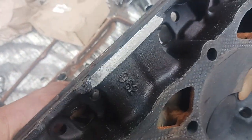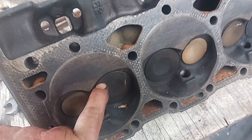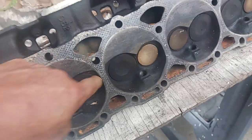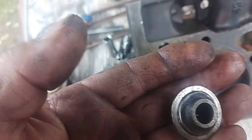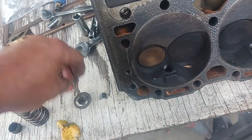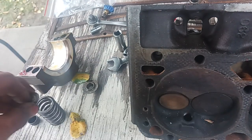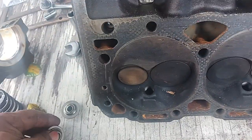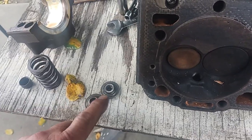I got a couple of good 062 heads. I checked the valve seats on them and they actually look pretty good. I'm still going to go in there and clean it all up. I took the retainers and I ground them — you can see the grind marks. I ground about 30 thousandths off of them. You can see where the locks sit. I didn't really take that much material off, just kind of flattened out the bevel.